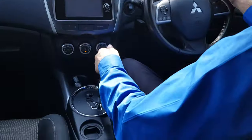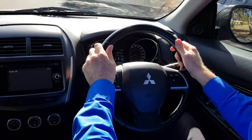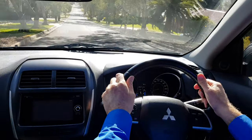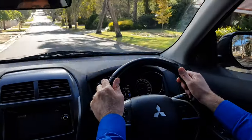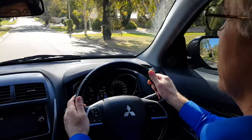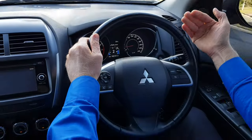Rather than use the brakes to hold the speed down, I'm going to put it into manual. This has selected the lowest speed — first gear — and it's holding the speed of the car coming down the hill. This is what we call engine braking. I'm going to brake a little bit to stop the engine over-revving.